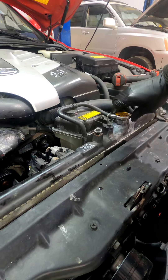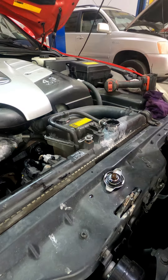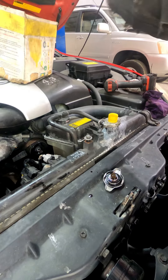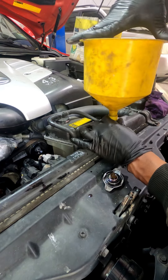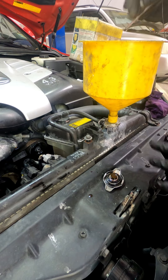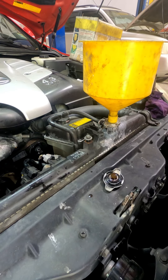When you're done, open your cooling system and get your funnel together. This tool has been around the block a couple times, but it acts like a giant funnel. It fills the system and even when it's burping bubbles out, coolant stays in the funnel. When you see it stop burping, you know it's good — then you can take it out.